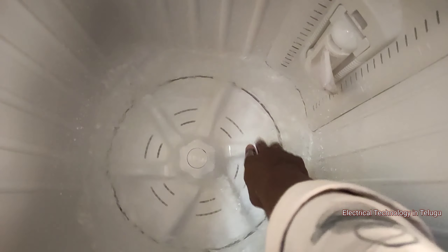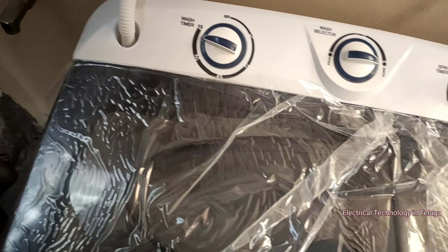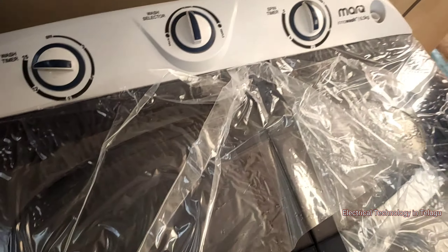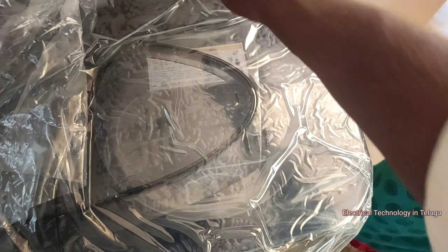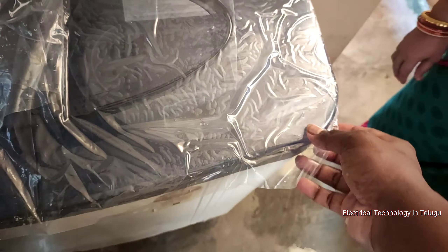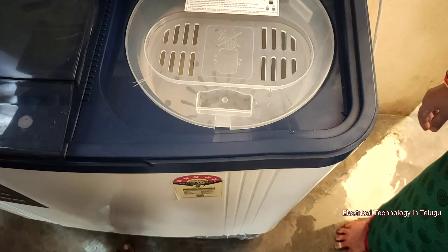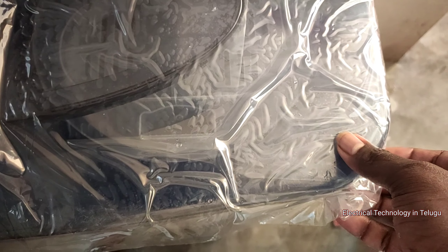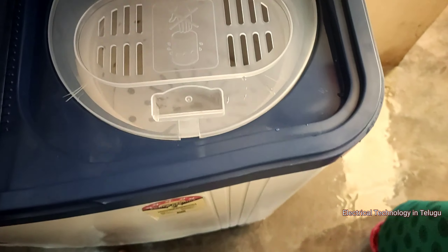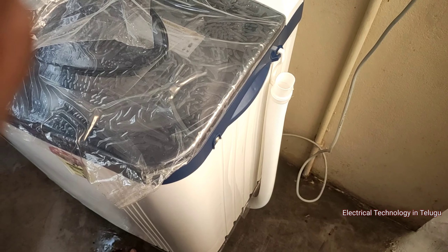Let's try the pulse at full power. There is the spin tub — spin tub is now on. If we open the door while it is moving, the brake and switch mechanism activates. The brake is cut off, the motor is cut off, and the power is cut off — a safety feature when the door is opened.